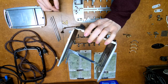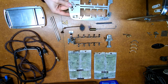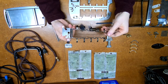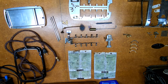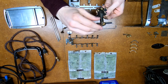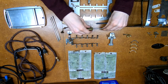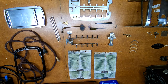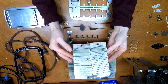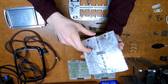Here is the shell assembly, here is the base that the shell goes onto and holds everything. The outside of the toaster is elsewhere. And then we have the arms here that actually lift the bottom of the bread up, along with the contact. All of this got thrown in a rust-removing bath and cleaned. The big problem I had when I was taking this apart was the electricals. The heater elements in toasters are typically a sheet of mica with nickel-chromium or nichrome wire wrapped around them. Unfortunately, these mica sheets are starting to disintegrate pretty badly.